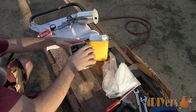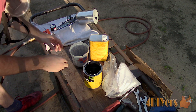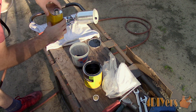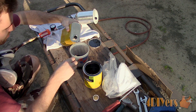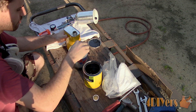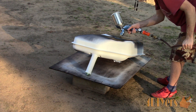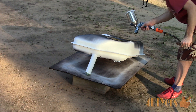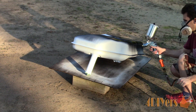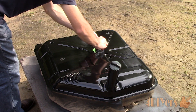As a final choice of paint, this is really based on personal preference. I wouldn't recommend using a rock guard, asphalt coating, or anything which can trap moisture as it can possibly cause future issues. Here I have farm implement paint from a local farm equipment supplier. This can be applied using a paint gun — which I'm doing here — or by hand using a paint brush or roller. This particular paint can also be thinned out for the gun and the mixing instructions should be on the side of the can. Work in a well-ventilated area away from anything you don't want overspray on, and use the correct safety equipment such as a respirator. Some areas may require taping off such as the filler neck and gasket sealing area for the fuel pump. I let one side dry for 24 hours before flipping the tank and painting the opposite side.